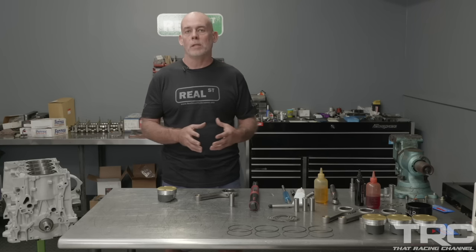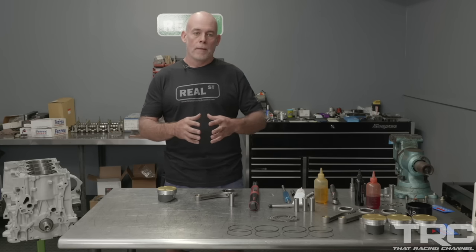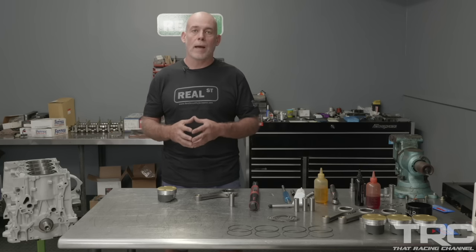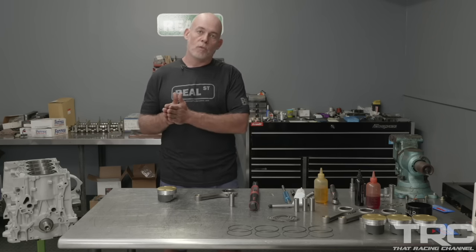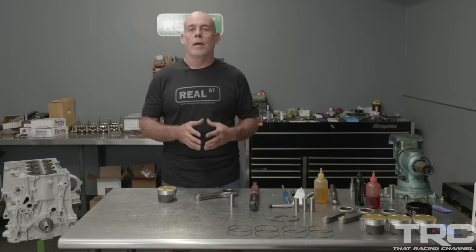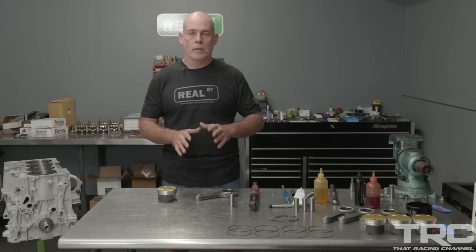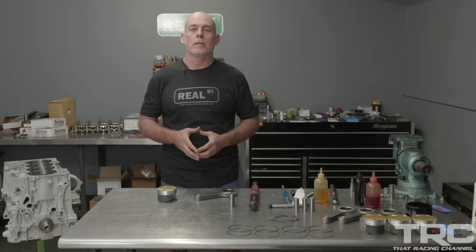If you look at certain communities like the GTR R35 community, when those cars first came out, a lot of them were putting the biggest engine displacement configuration that they could in those cars to make power. However, they had problems with the crankshafts cracking because of that internal leverage. So as that community matured, they moved back towards lower stroke values because it took some of that leverage away and kept the crankshafts alive longer. Same thing we're doing here. We're going to have an engine that can make, you know, 800, 900 horsepower and live well. And we're going to do that by alleviating some of that internal friction, letting the turbocharger do the work.